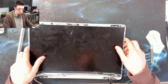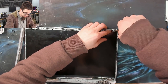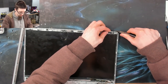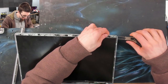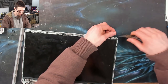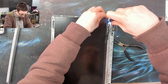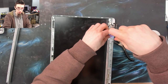On this one there's a little bit of tape poking out the top and some at the bottom as well. Some laptops you'll only have it at the bottom so you may need to undo the strut bar screws to get to the pull tab. I'm going to grab a pair of pliers and just get a hold of that and start stretching it up. As you can see it just keeps going — until it snaps. Don't let it stretch too far; you need to keep grabbing the base as you pull.